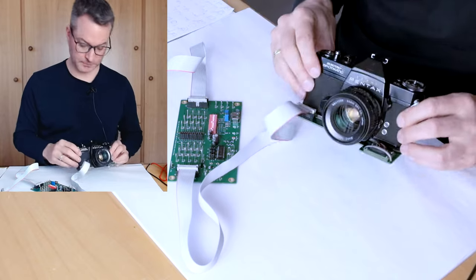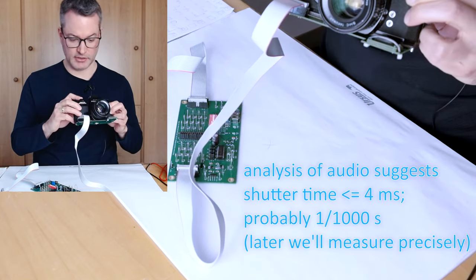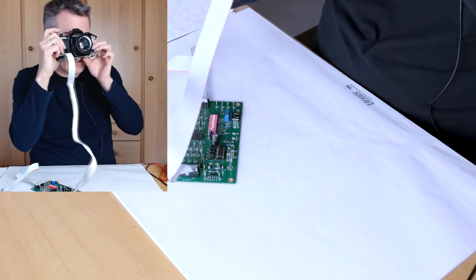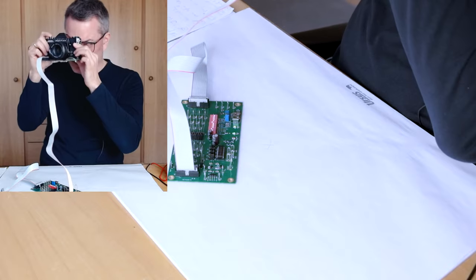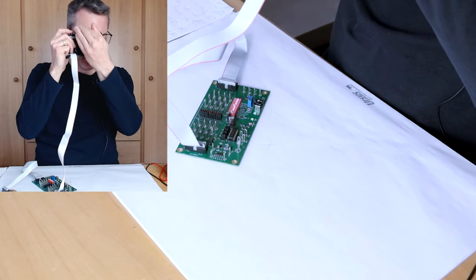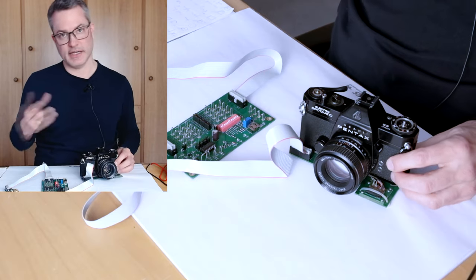Now that everything is connected I can tell you about the symptoms of this camera. If I release the shutter you can hear that it always sounds like a very fast shutter time, no matter if there is a lot of light or hardly any light entering the camera. I do see some reaction to the light — pointing it directly into my video light indicates 1/250 second exposure time, and pointing it elsewhere indicates less. But the variation is much too little: from pointing it directly into the video light to mostly covering the lens, it only goes from 1/250 down to 1/60 second — way too little for this large difference in light. So something is not right with the light sensitivity of the camera.